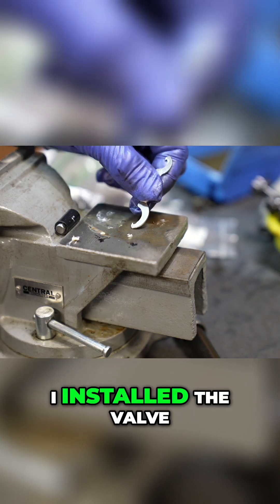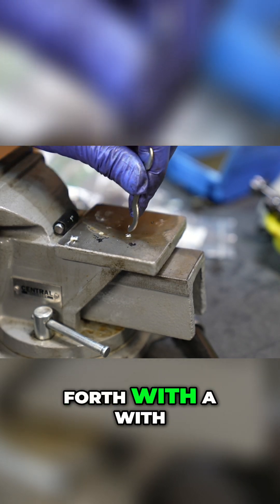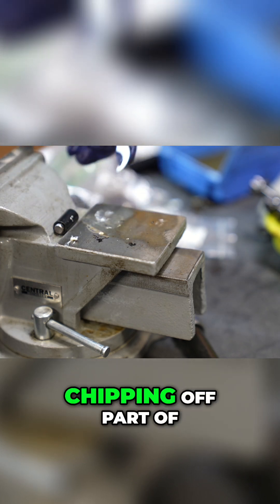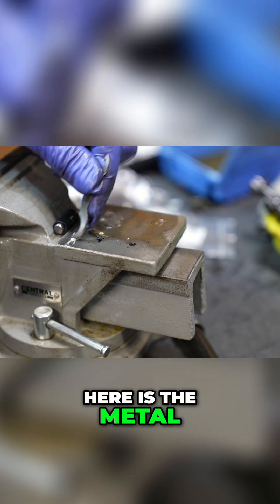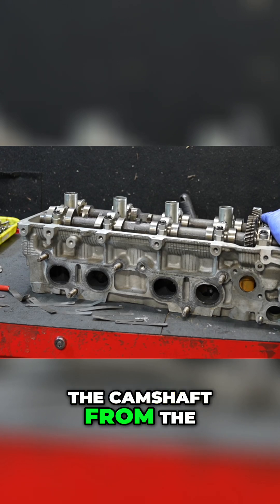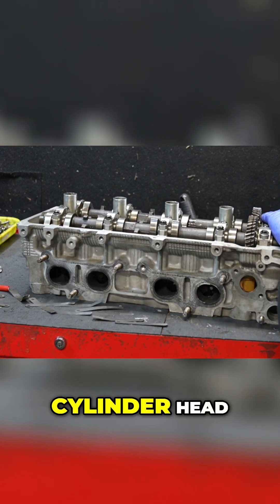I don't recommend doing my friend's trick of hammering on the valve stems. It's also perfectly possible I installed the valve keeper wrong. But I did learn one lesson: when rolling the camshaft back and forth with a 27 millimeter with just the exhaust camshaft in, I was chipping off part of the cylinder head. Here is the metal. Regardless of whose fault this is, you need to turn the camshaft from the front intake cam lobe so you don't chip off part of the cylinder head.